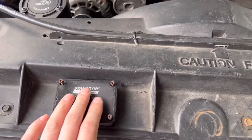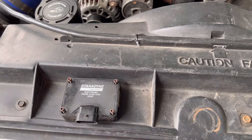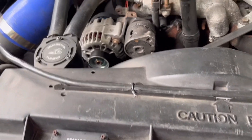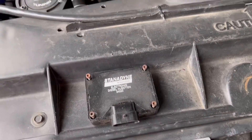Now that we've explained the PMD — this is what fires your injection pump. It's kind of like a brain of sorts. There are resistors on the back side and they are calibrated. Injection pumps are typically calibrated to the resistor inside the plug as well.